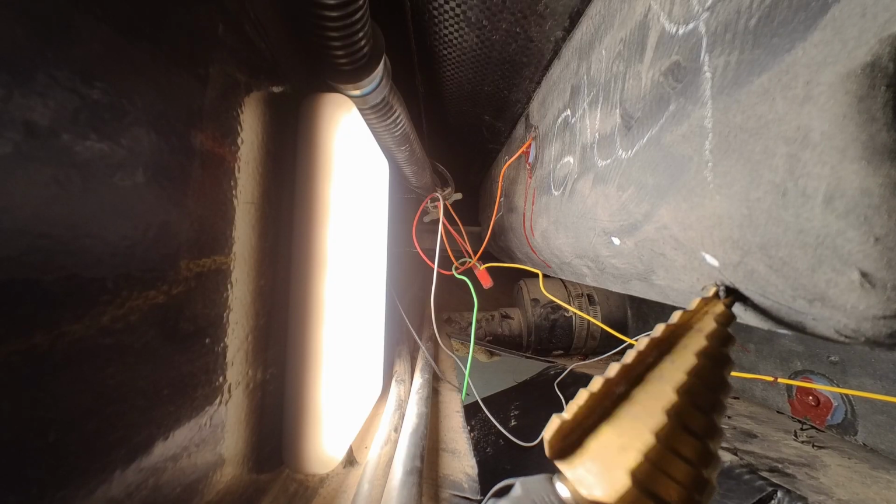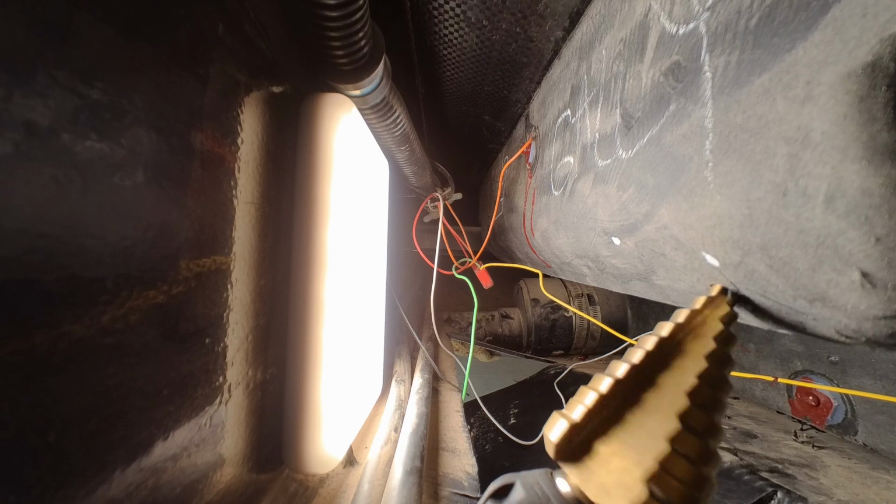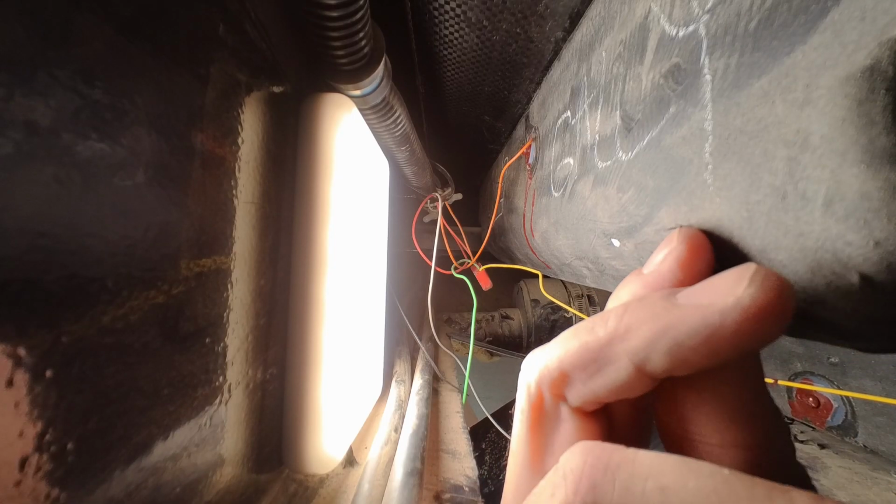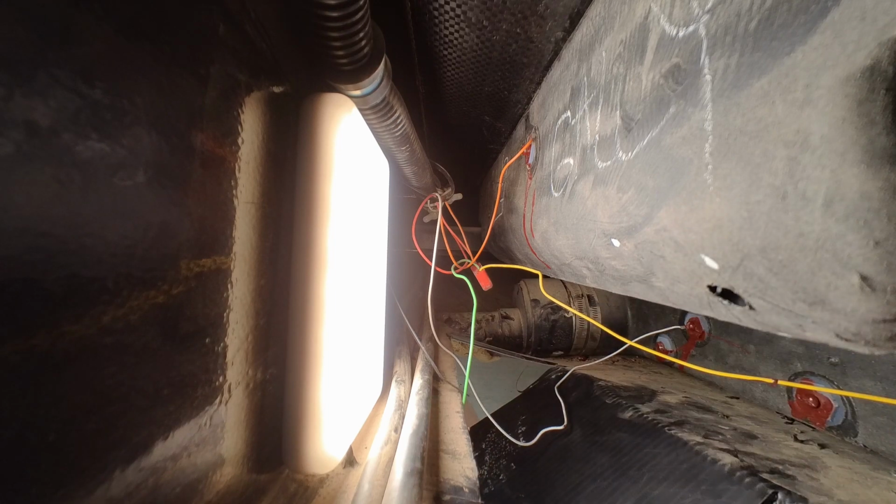It was easy to drill in. The plastic is pretty soft. I just took my time, made sure it didn't wander. The small starting hole that the tapered drill bit offers gives you a pilot hole to keep the drill from wandering, and that was a good thing. I just made sure the hole was clean and free of debris from the plastic of the drilling.